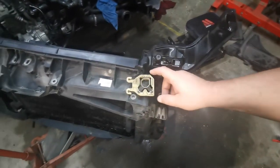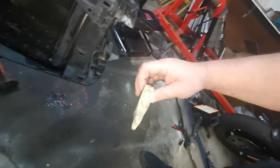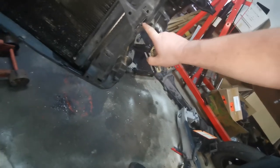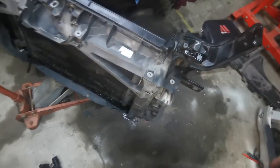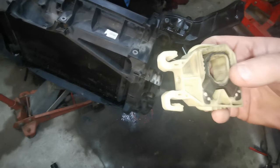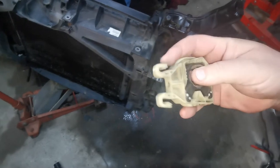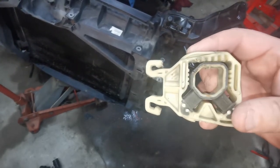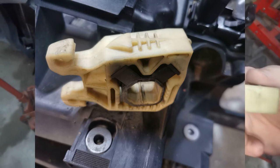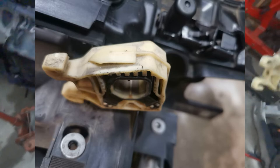The second set of clips are by far the toughest. They are at the top, towards the top of the intercooler, jammed into these two little slots here. I've seen some guys drilling holes and all sorts of stuff from the top. There's actually a little damper rubber in here which takes the shock loading of the radiator — the vibrations out of it. It's a special shape so it only goes on one way — you can't put it upside down. There's an arrow showing which way is up.